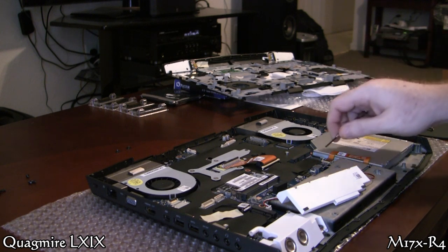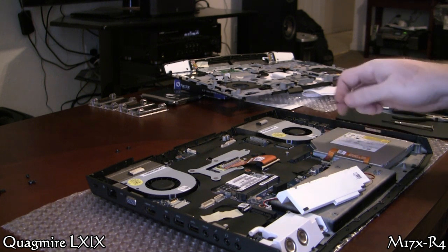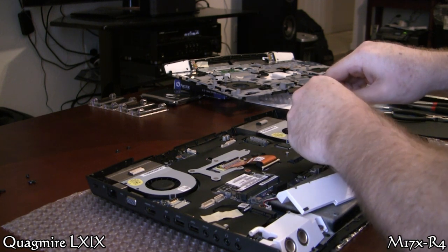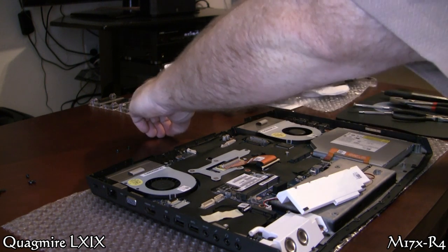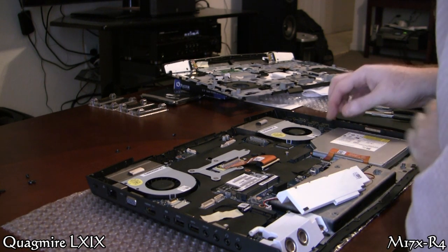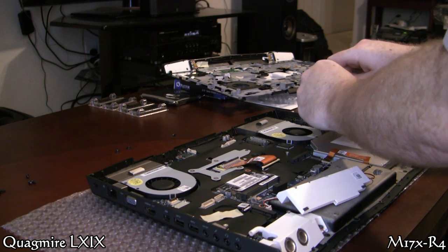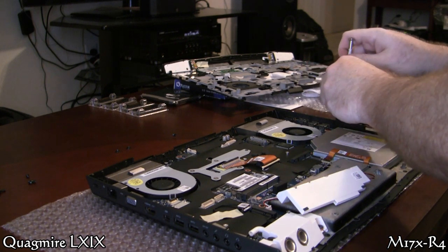All that work and we've finally got to the optical drive. There's a little latch release — same kind of ribbon latch release as your keyboard. You've got a couple of screws there and you'll pop your slot drive out real easy. The slot drive has a bracket around it, so you have to replace that bracket onto your new slot drive. I'm very impressed with the instructional steps of the manual — they teach you very well how to disassemble this and even show you reassembly steps. Well done on Alienware; they want you to go ahead and work on it yourself, and they want you to have good information for it.